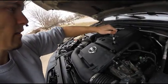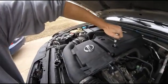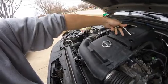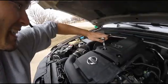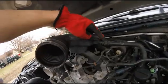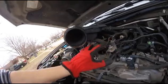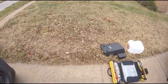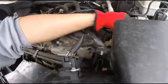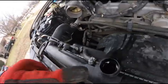While the coolant is draining, I'm going to take off this hood and the shroud and the air duct. As you can tell, I'm not a mechanic. Okay, I've got that just setting up here. I didn't disconnect it here, otherwise I could pull all of this off. But I put the bolts back in here. These 2 bolts are actually in the shroud there. So this could actually be taken off further. I don't really see the point in it. All right, I lied. Now that that's all out of the way, everything's almost drained from the radiator.